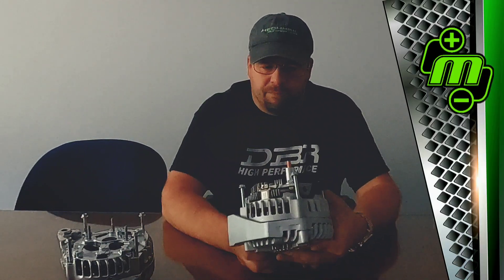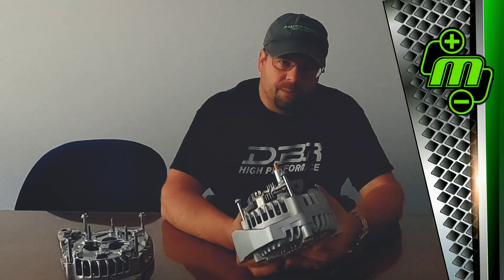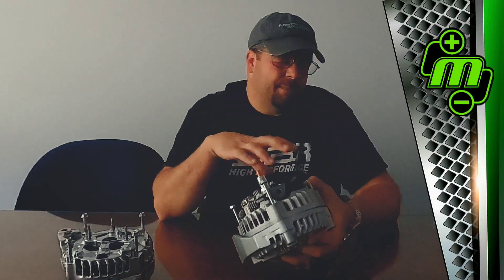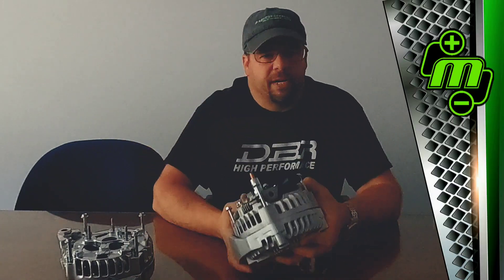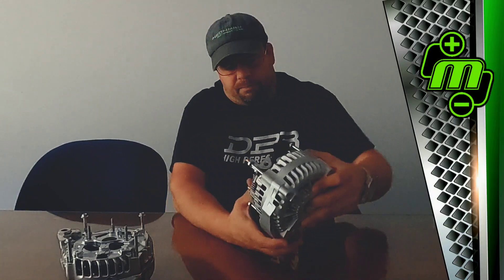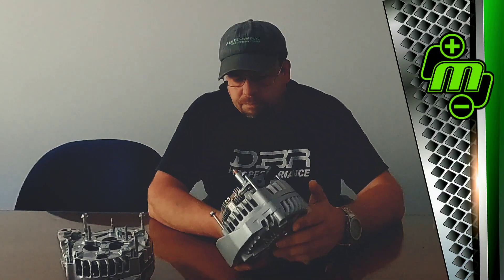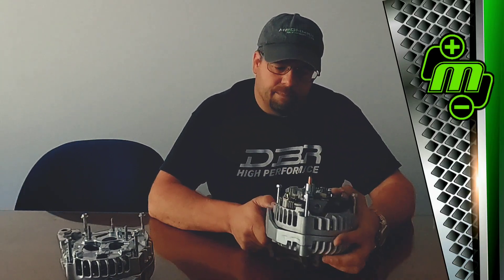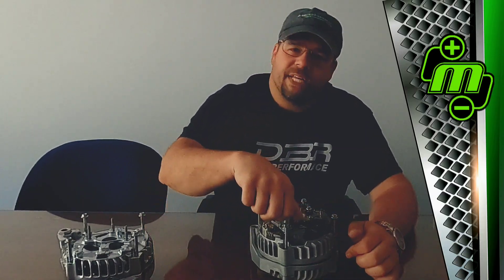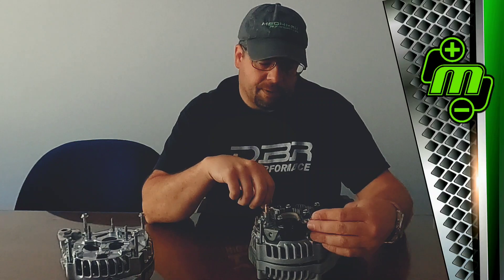Even the Camaros are this way. But say you're doing some custom application or a motor swap — you have different valve covers, a different bracket, a roll bar, cage tubing, front-half car, something like that — and for whatever reason you don't have clearance because your mount has it positioned a certain way. All those little things add up. What we can do is move the output stud or change the clocking. That customer I had was very good with pictures, detail, and measurements — spoiled me a little bit.